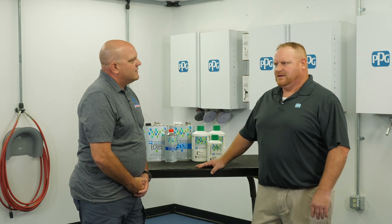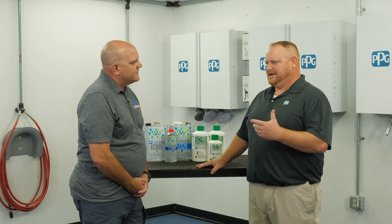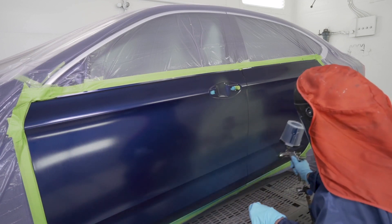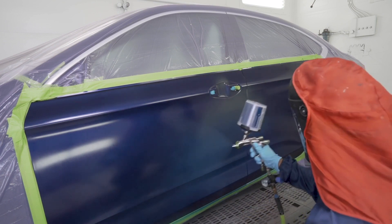So we've covered hot and humid, we've covered hot and dry — what about something in between? We're going to call that the sweet spot: anywhere from 80 to 100 degrees temperature-wise, and 30 to 50% relative humidity. Things are going to spray fairly normal and dry really fast. Your blends, control coat — everything's going to lay down really nice. I would call that a sweet spot, and you're going to be able to get in and out of the booth very fast at those temperatures.